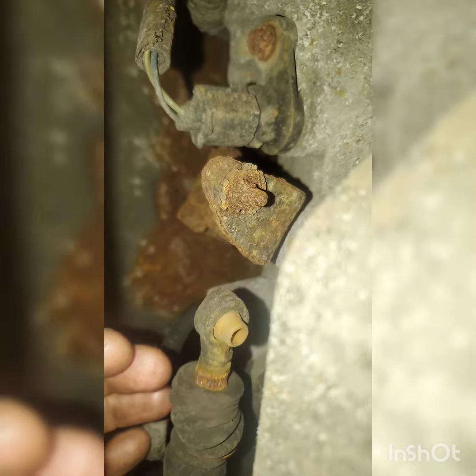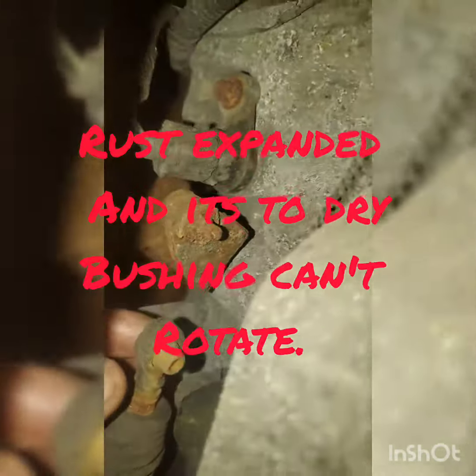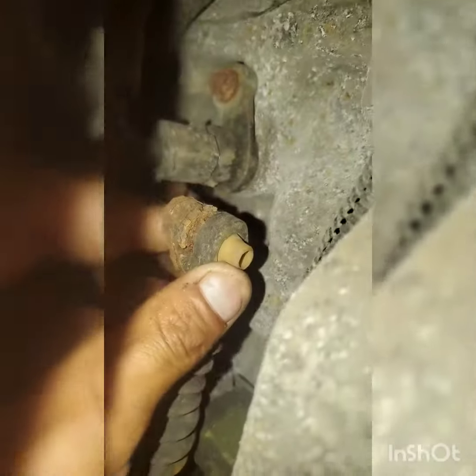You come under here, right? And you look at your shifter cable, which is right there. Shift it, look at that, it popped out of place. So if you just need to get home, stop right there. If you need to get home, go back a little bit. Right there. Just pop it in place like that.